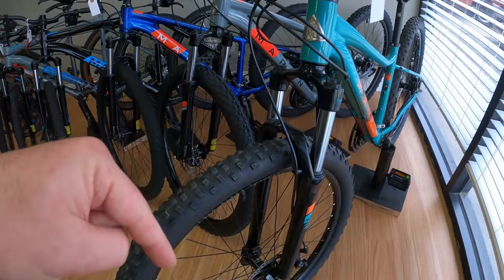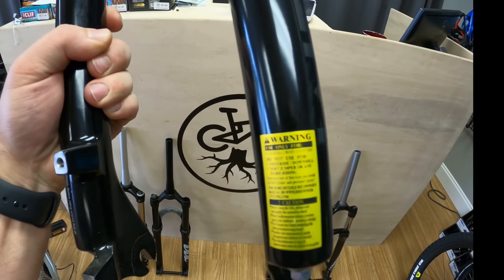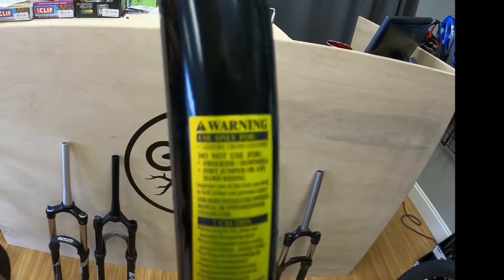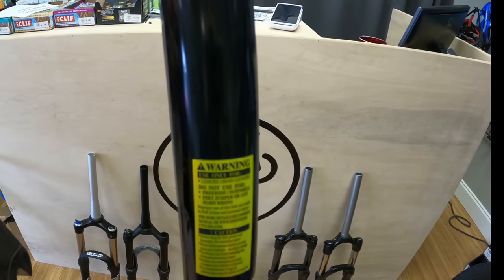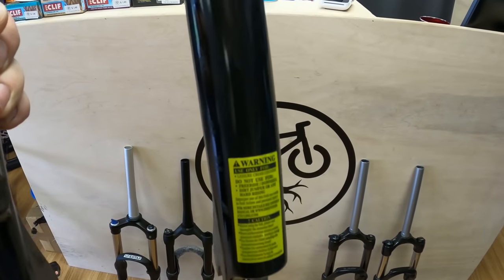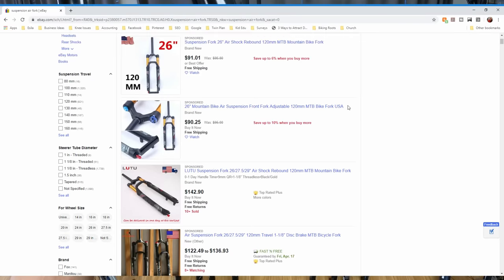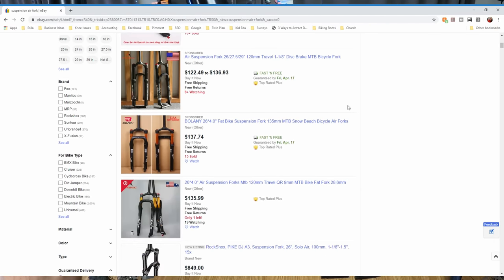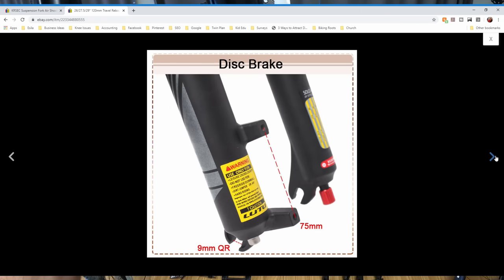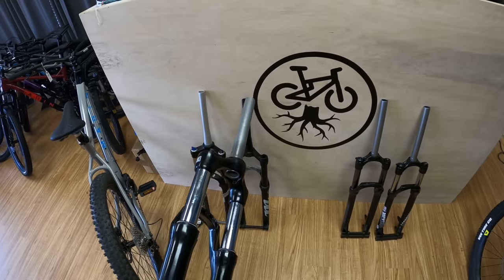If you have any questions, leave a comment below — it can get a little techie. Take a look at the fork you have. You'll probably have a yellow sticker or something that says what it's for. On this one, it basically says 'for leisure cross-country only.' You'll find that on many budget forks that come on inexpensive bikes — they're just not designed for normal mountain biking, in my opinion. You can take them on some light trails. On eBay you'll also find a lot of generic brand forks from Asia, and most of those also say leisure cross-country only, even though they're air forks.